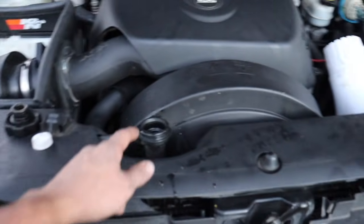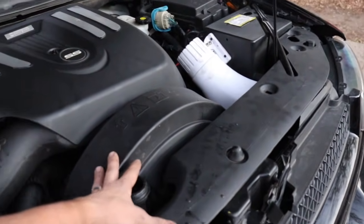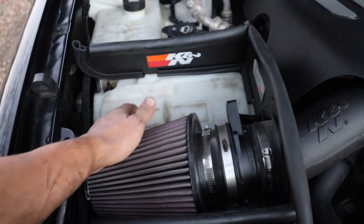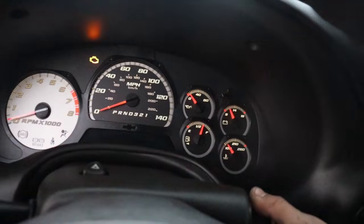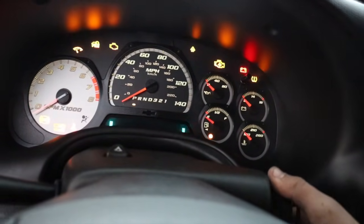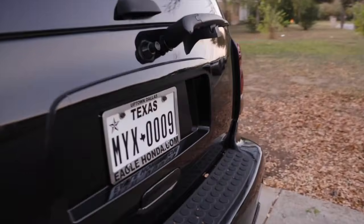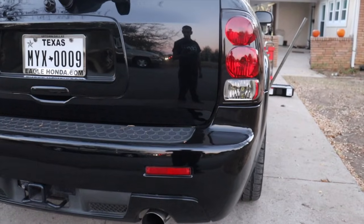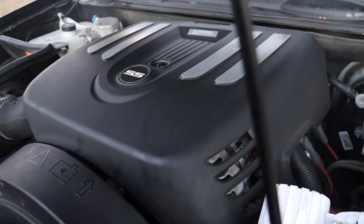Alright guys, so I got it done. I'm putting coolant in it right now. It does take longer on this one — you gotta take everything out. It's a pain to take the radiator off. You gotta take the whole front end off, and then take out the windshield wiper fluid tank — just a pain in the butt. So here we go, first start — see what it sounds like. I'm gonna go ahead and prime it first. Good oil pressure — I always like to keep an eye on that. Not bad, sounds pretty good. Motor, everything's good here. No leaks, anything.